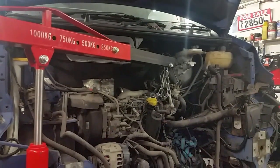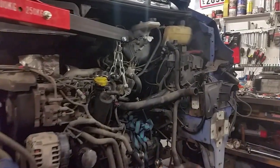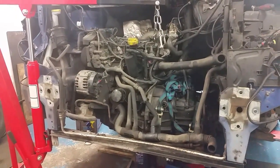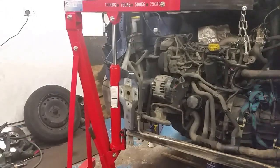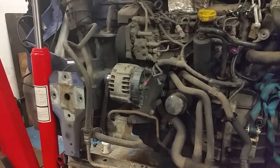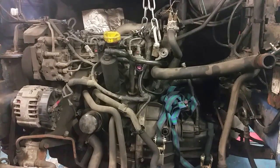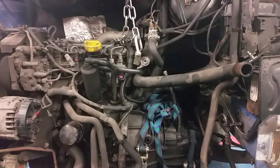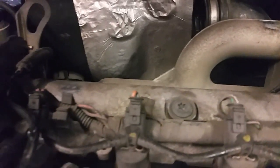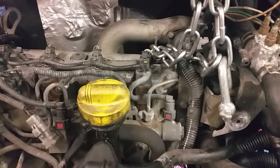As I say, it's designed to do that. People may think you're mad pulling the front end off, but it's a wee bit like the longitudinal Audis and Volkswagens where the service position is you pull the front bumper right forward and it allows you access. But on this thing the front comes off completely and in about half an hour to an hour everything is just looking at you. When people think these are a real pain to work on, they're not really. The starter motor is a bit of a pig to get out because you have to move the exhaust, and the turbo is hanging way down below at the back — so the things at the back aren't so good. But your injectors are all just right beside me — they might as well be on the bench.